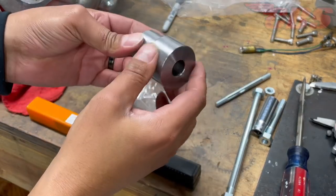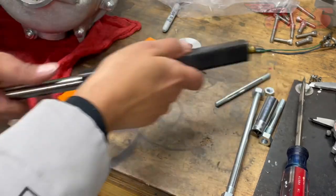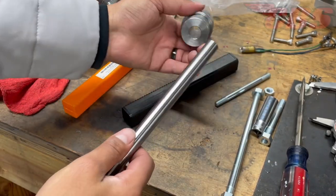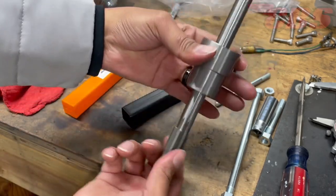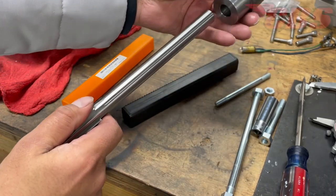We're going to grab our CBS pilot. You can purchase the same camshaft bushing reamer kits used in this video off of our website. Each of these pilots are honed on the honing machine, so it is a very smooth, precise fit on the reamer.